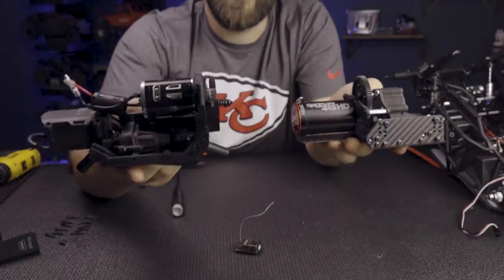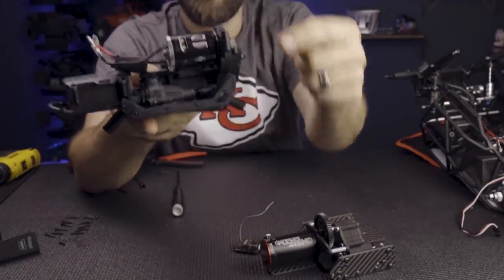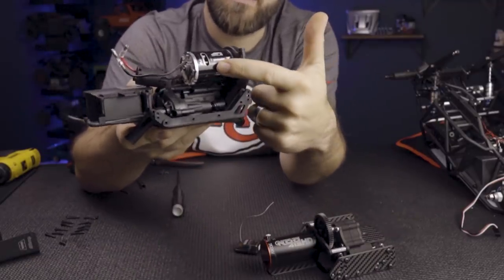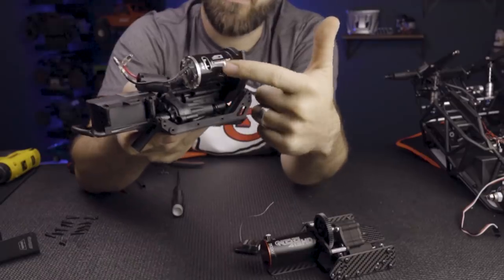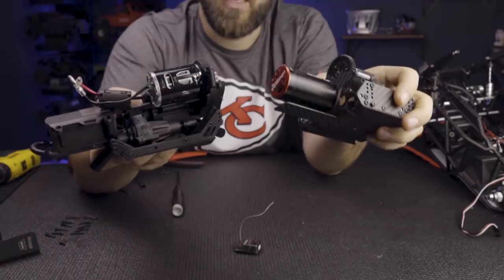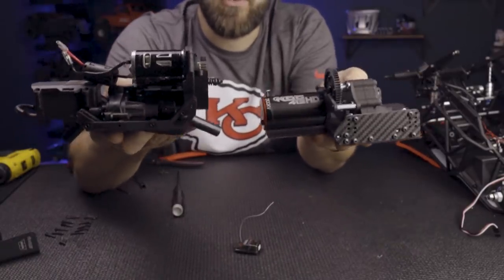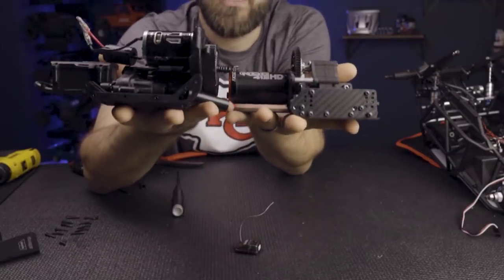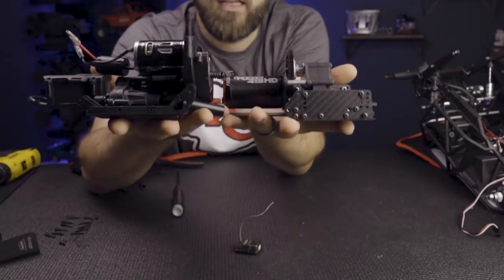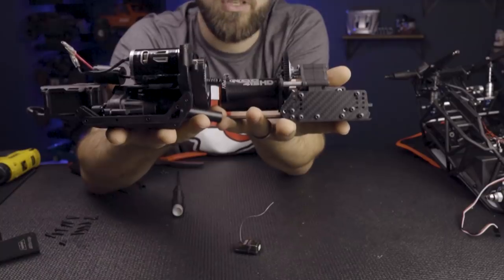Now here is why we're doing this mod. Here is the old transmission — you can see how high the motor is up there. There's a huge difference between the bottom of the skid plate and the center of mass of the motor. That's definitely going to raise you up quite a bit, especially when you start putting in a heavier brushless motor like we have here. With the new low center of gravity version, once you get those skid plates on the same plane, you just have this massive difference in center of gravity — much more efficient, and a much more compact transmission overall.